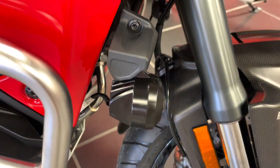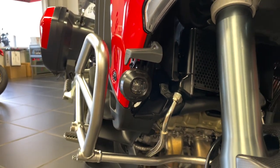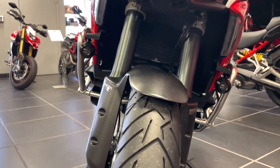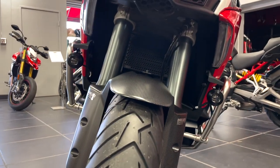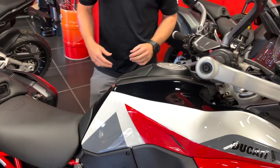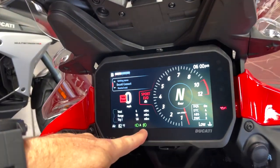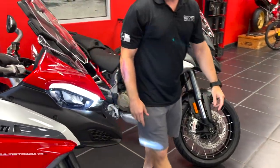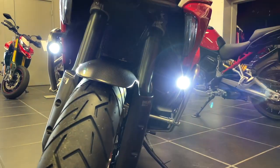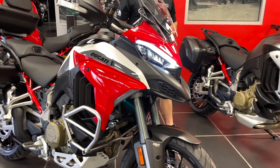Obviously we've got the auxiliary lights right here. This is a bit of a change-up from the previous Multistrada DVT 1260 or 1200 — you now don't really have to worry about whether you have crash bars or not. You can see they are mounting to the bike regardless of the crash bars, so no concern about whether it's going to work. For the auxiliary lights, since they don't have their own button, you hold down the daytime running light button and you'll get the auxiliary lights — highway lights, fog lights, whatever you'd like to call them. They will activate when you hold that down and it will not impede the automatic daytime running light function. To turn them off, just hold it down again.